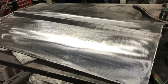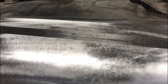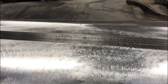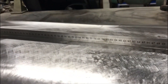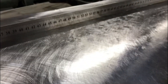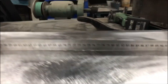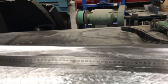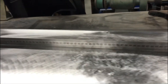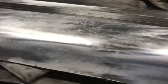This is the door that I've been metal finishing. I've probably got, in actual panel beating, about three, maybe four hours tops to get it to this stage. It comes along pretty quickly, mostly because as a panel beater I'm pretty used to doing this stuff. There's a slight little bit of daylight here and there, which we can still dress up. We don't know - you just keep at it until it's come up good.